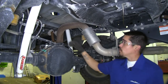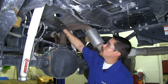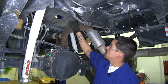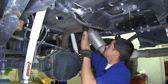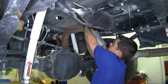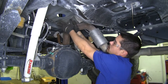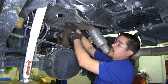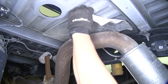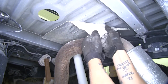After drilling our hole, we'll come back to the heat shield next to the hole above our axle and above our exhaust. This is just glued on, so we're going to pull the heat shield down — it won't be reinstalled because the hitch itself will act as a heat shield between our bed and our exhaust. We just reach up and work our way around, pulling it down.